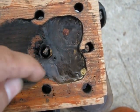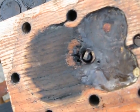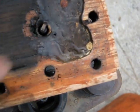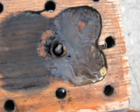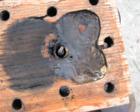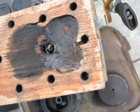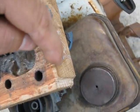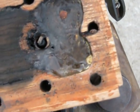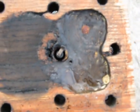And another one doing the same here, as well as a big area burned out around the spark plug. These are where I put in the liquid plastic, injected it in with a syringe — some of the moldable plastic I make things out of. I thought that would close up these tunnels that lead to the outside of the head, and it seemed to. I put a little JB weld on there just to make sure, and there was a third one right here that I ended up JB welding.